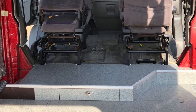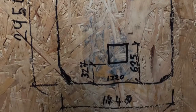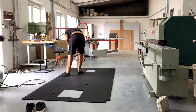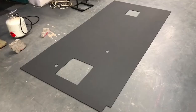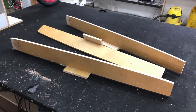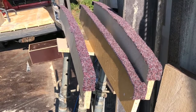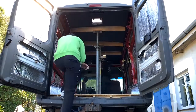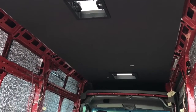The roof panel I measured and cut out of 3mm MDF, making sure all cutouts fit and marking holes for lights. I used thick black fabric I had spare at the workshop to make the final result softer and thicker, with a second layer of interior fabric for a unified style. Next I made a few stands out of chipboard — these curves copied the internal roof shape and I stapled strips of fabric to protect the new ceiling fabric. Installing this panel was easy: I used PU mammoth glue and pushed the panel hard against the roof. The following morning the glue was cured and we were ready to move on.